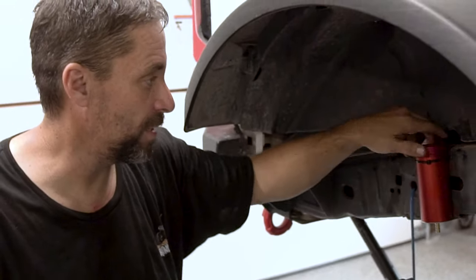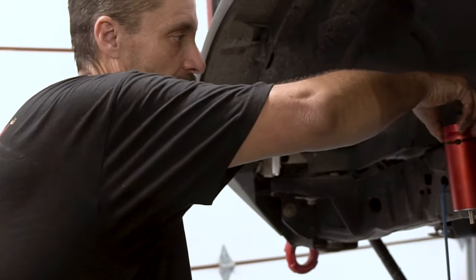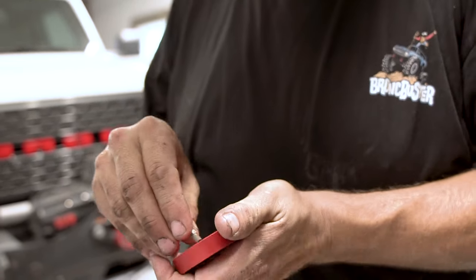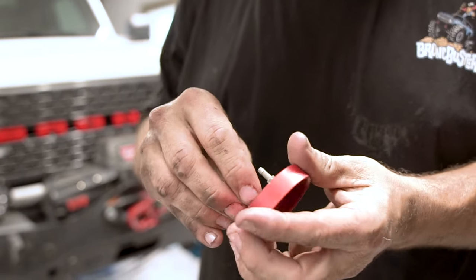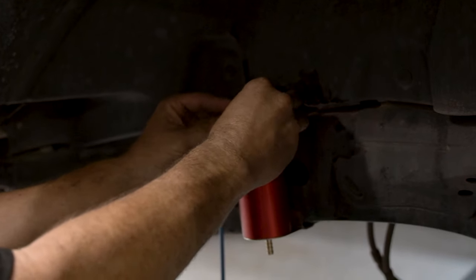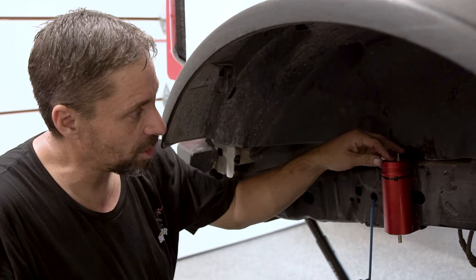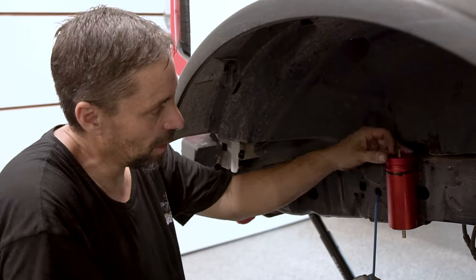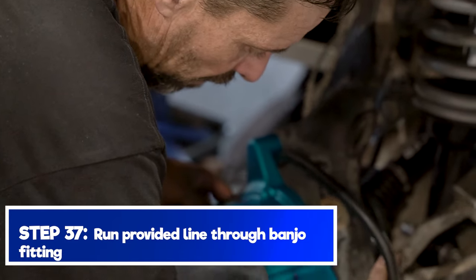So on the top of this, there's two small holes. In this case, you're gonna wanna put some barb fittings in there and get some small hose. You're gonna wanna take those hoses, loop them together, probably put a loop in it. We don't ever want it to pull moisture from, you know, going through water or something into this and then down into the portal. So put it on there.